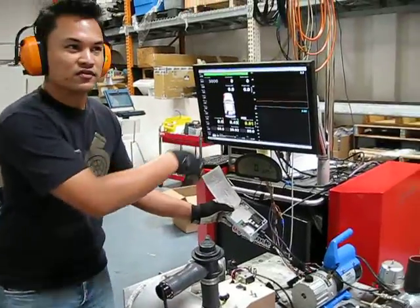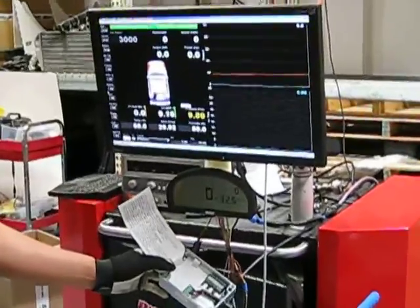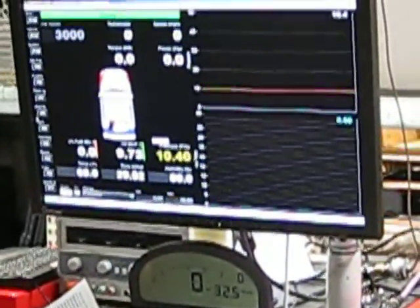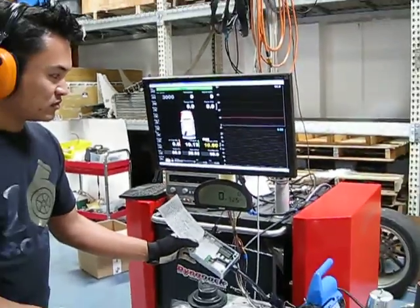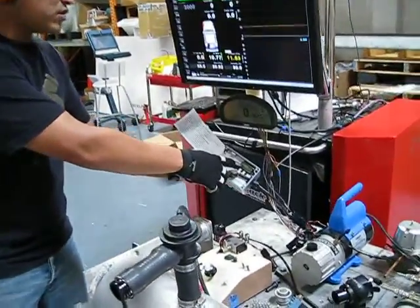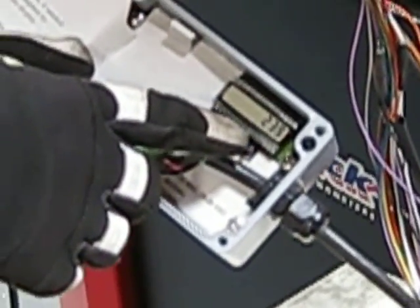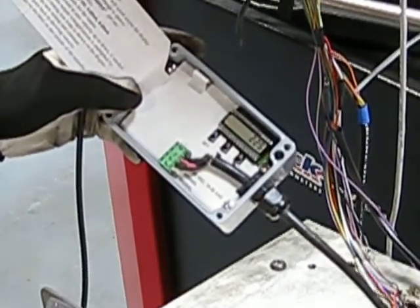It's not even pressurizing fast because it can't — it's supposed to be at like 15 psi already. The max it hits is like 12 pounds. At only 11 pounds of boost it's already leaking 260 feet per minute. It's only able to hold like 12 pounds when everything else can hold like 15 pounds.